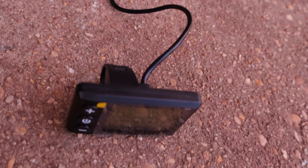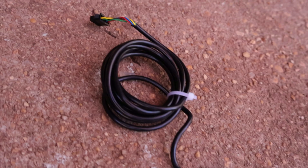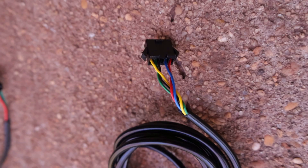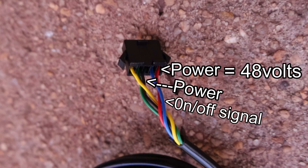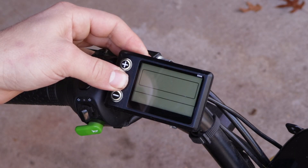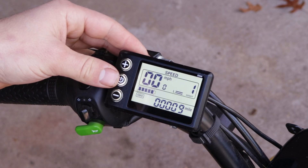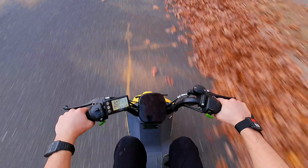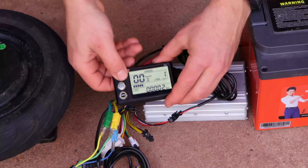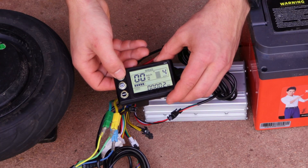Starting with the display, which might look complicated at first, having a total of five wires. The red and black wires are obviously power, although the red wire is actually the same voltage as the battery. The blue wire is for the display, telling the motor controller when to power on or off. And finally, we have a green and yellow wire communicating between the display and the motor controller — for example, how fast the e-bike is moving, or what speed level the motor controller should drive at.